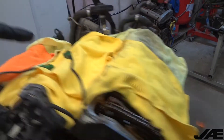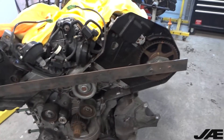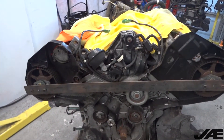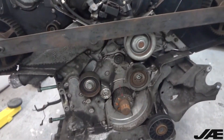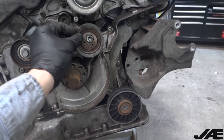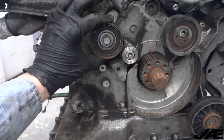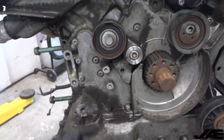There's no issue with the cam chain tensioners. What I'll need to do is get my different cam lock bar and pull off the pulleys, line up the cam marks to make sure those are all correct, and then rotate the cam pulleys once I bolt it all back together. The second thing I found when I went to pull off the belt and double check the pulleys and the water pump to see what I could reuse — everything felt good, and then I went over to the tensioner roller and realized they completely forgot to put the washer to retain the pulley on the tensioner roller.